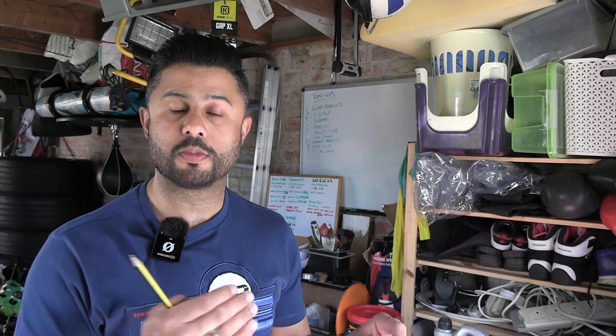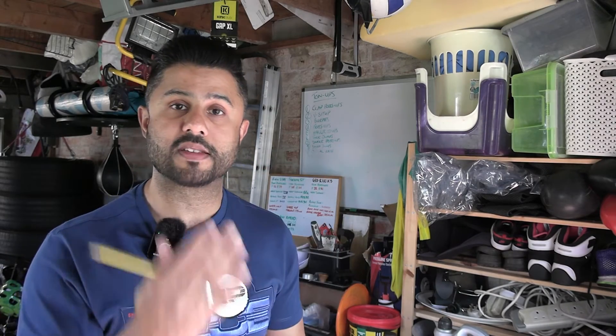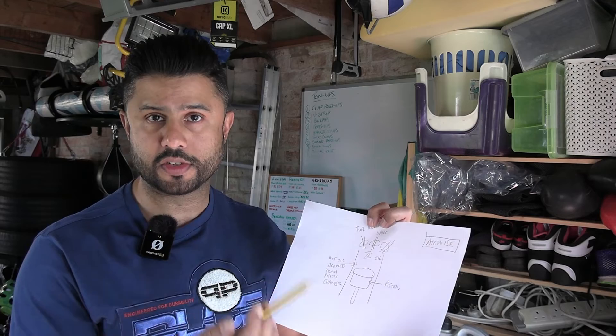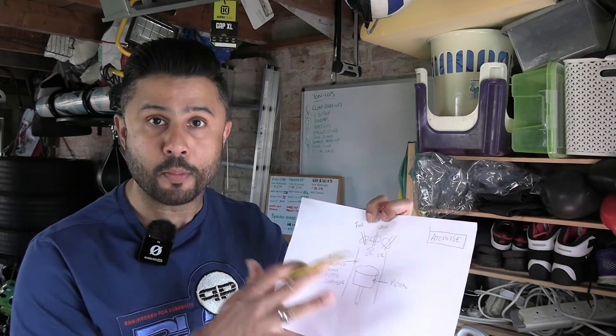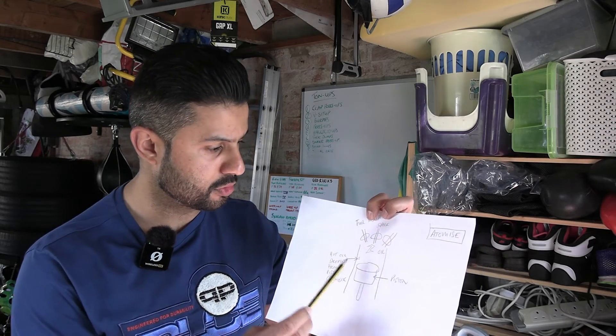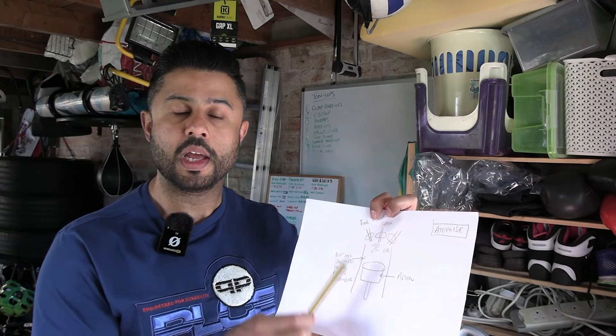Also make sure that you don't increase acceleration from a gear that's too high. If you're in fourth gear when you should be in third, don't accelerate from low RPM — that's going to put an excessive load on the engine. This may affect standard cars, but certainly according to Sparkplug Steve's analysis it's more common in a car that's going to be tuned. And obviously my car is going to go for that Stage 1 tune, so it's extremely important for me to make sure this is taken care of.